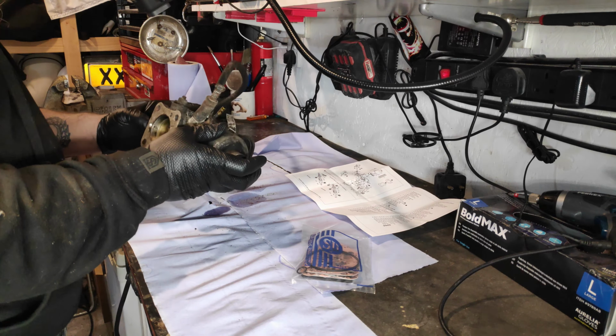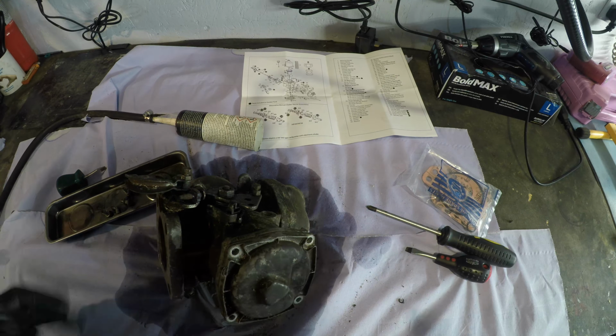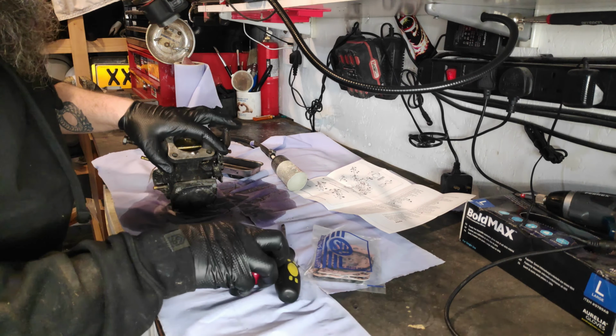Like I said, these things, because I had a Mini, well, the Austin Powers. I parked that running in 2003. And I started it again around about 2017, after I changed the head gasket. I stripped it to have a look at it anyway, just to make sure that the engine was okay, and I cleaned it all up, stuck it all back together, and got the engine running before I pulled it. That was the easiest thing to do. When I did that, it had been stood that many years, and it pretty much just fired up on a drop of fuel. Admittedly it was dry stored in a nice sort of place, however you don't always get that.